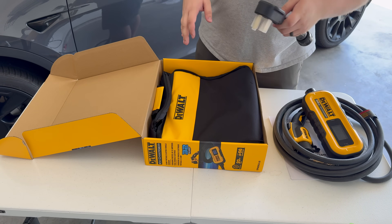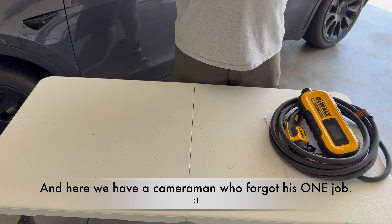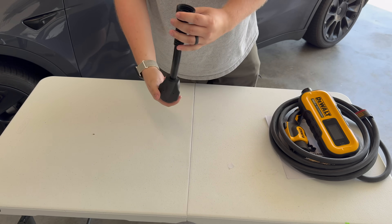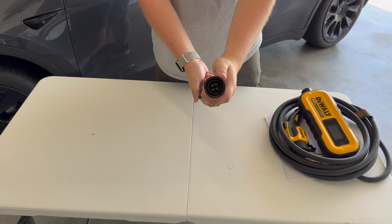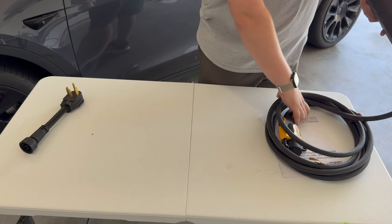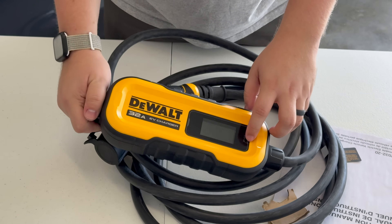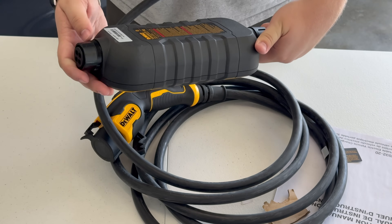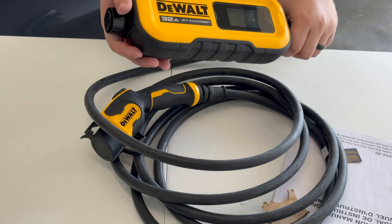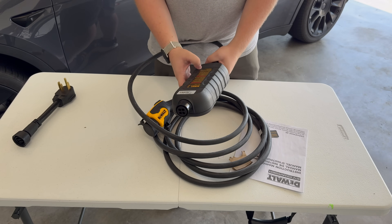Let's look at the EVSE. This pigtail is a 14-50 — it says 'Huanwa' on it. It looks like it's got a screw-on locking connector; it's a four-pin situation, so it's your three pins plus probably some form of communication to tell the charger it's a 14-50 plug. The unit has a long thick cable and the body says IP66 on it — I'm assuming that's the model number, though maybe they're saying it's IP66 rated. It does look like it supports 120-volt, which is nice, so you could use this as a Level 1 or Level 2 portable EVSE. It's manufactured and imported by Paragon Group USA.